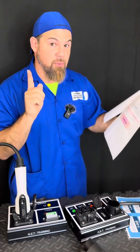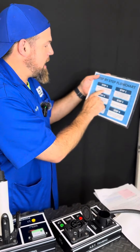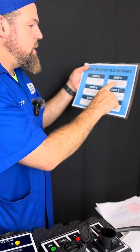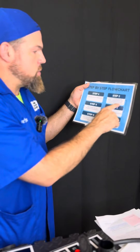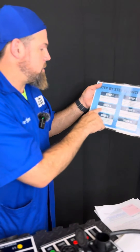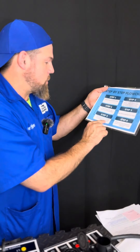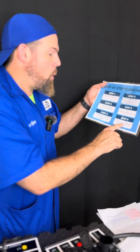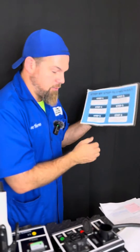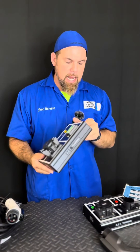Email if you want to contact Professor John Foro — I'll give you the link in the description. Step one: diagnose any high voltage diagnostic trouble code first. Step two: use the box to verify the charge — a green proximity light or module should be illuminated and voltage should be present. Plug the detective box into the vehicle. Plug the charger into the detective charging port. Monitor the line voltage and the control pilot circuit once charging starts. Perform point-to-point diagnostics on any vehicle circuit if needed.